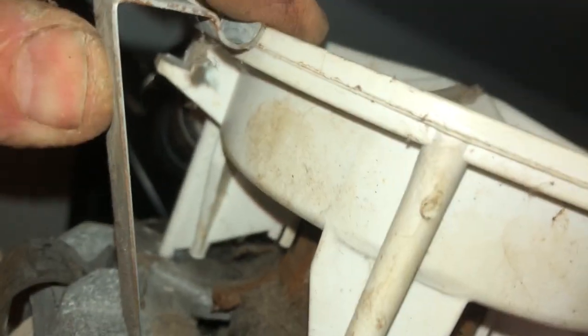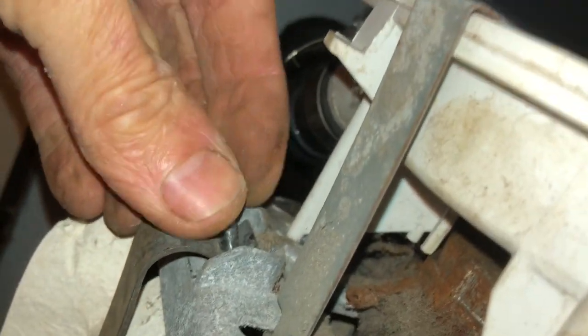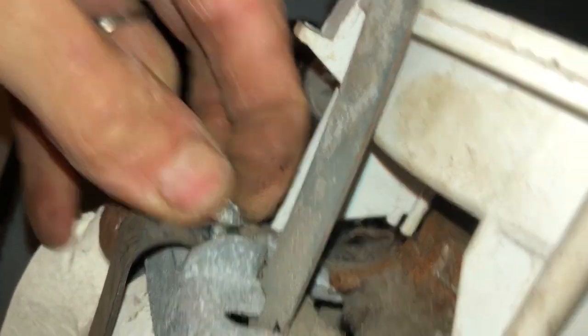So now we're going to put the water pump back on, and we got to get it back over the shaft, but you may have to turn the shaft so that it fits correctly back into the water pump. So that's nice and snug. That's back on there. And we're going to put the 2 spring clamps back on that hold the water pump to the motor. There's the top one. There's a little slot that you push it into, and then you turn it, and you can use spring tension to put it up on there. And I'll put the 1/4-inch screws back in, top and bottom.